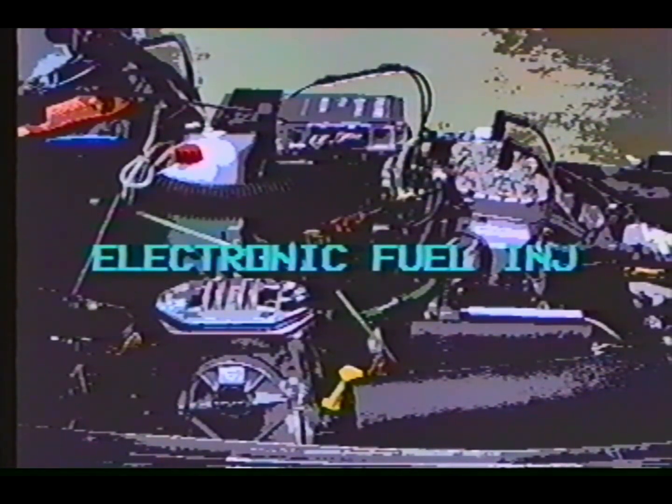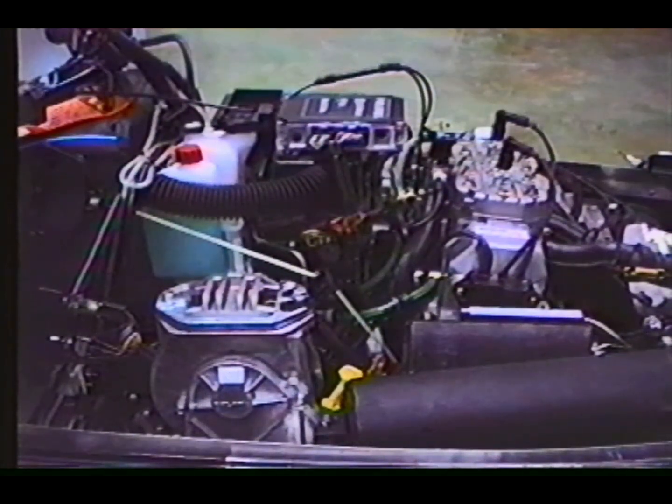In this presentation, we will cover changes made to the 1993 EFI 500. Some of these changes include a new method now used to power up the EFI system, the MR control screw adjustment and the effect that it now has on startup. We will also cover throttle sensor testing, troubleshooting, and other important tips. This videotape should be used in conjunction with the Master Repair Manual EFI section. Reference should also be made to the 1992 service tape EFI section.